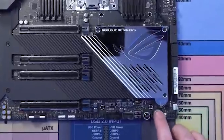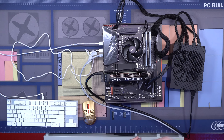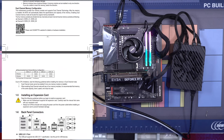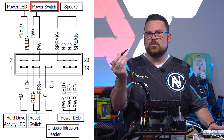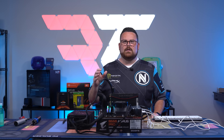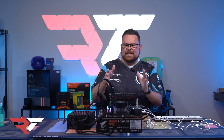Now the whole thing is built and plugged in — what do you do? If you don't have one of those bigger budget motherboards with a built-in power button, I'll show you the more universal method using the front panel connectors. Turn on your PSU so the board is getting power. Down at the bottom is your front panel connection — look in your manual for the two pins labeled 'power switch.' Using your flat head screwdriver, jump those two power pins. Your PC will now start booting.